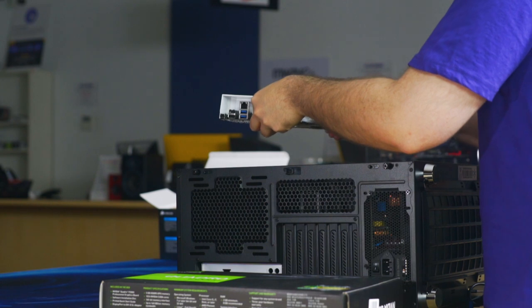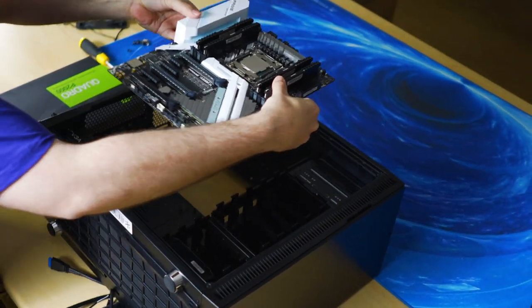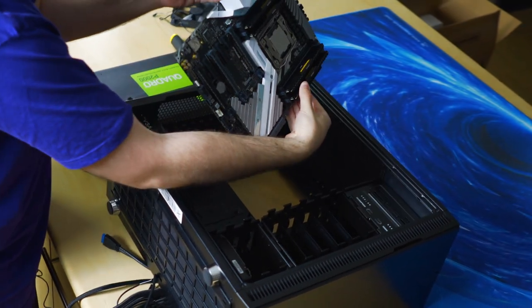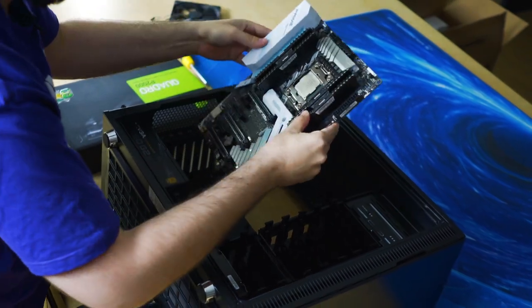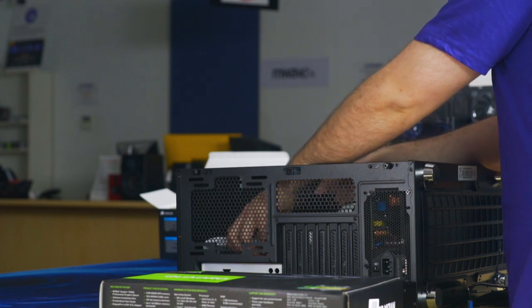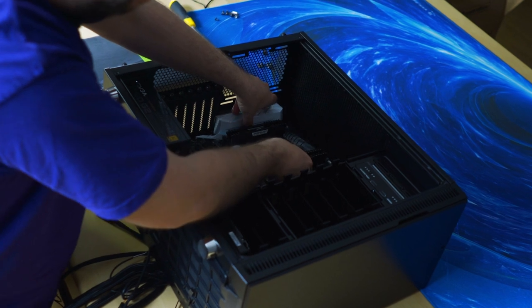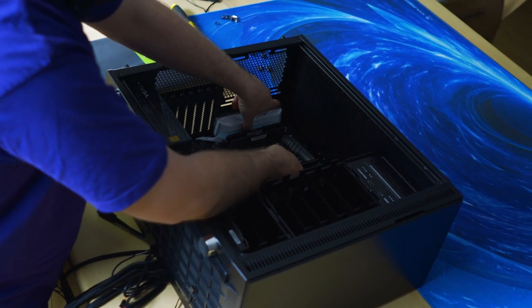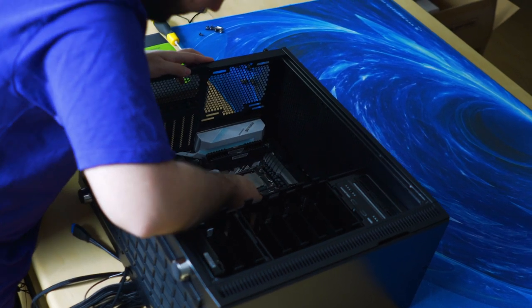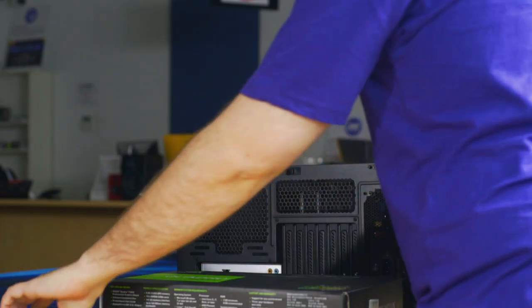Realign the motherboard to be in a vertical position. You want to tilt the motherboard and try to line up the rear I.O. to the rear of the case, to that I.O. shield that you have. So you want to lower down towards the rear I.O. using the plastic fancy thing on the ASUS board to help guide it in. Lower the motherboard down and line it up with that center motherboard stand. Okay, once that's in,